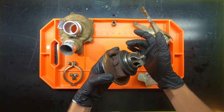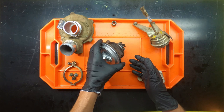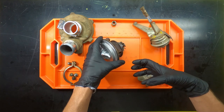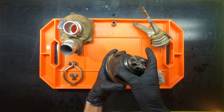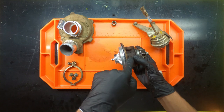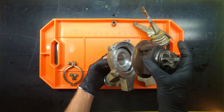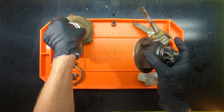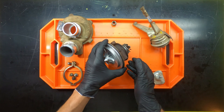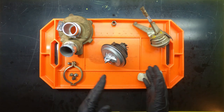And then with the dowel pin, once I install the compressor housing and get all that put on, the turbine housing will be on there and everything will be properly clocked. Now, I know I did mention at one point you will see the markings here, but I know this is the bottom and I know that the line was on the bottom. So when I match these up, I'll be able to see where the bolts were, and that gives the perfect clock for when it's installed. You don't have any fitment or interference issues whatsoever. So let's get started.